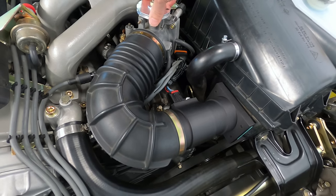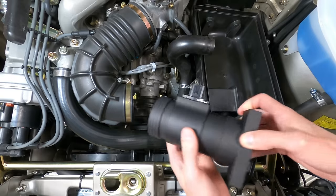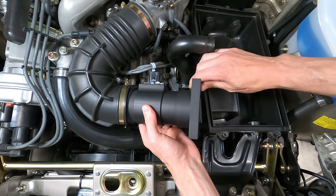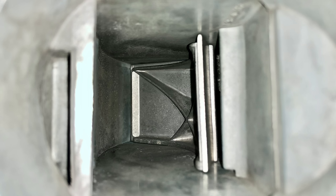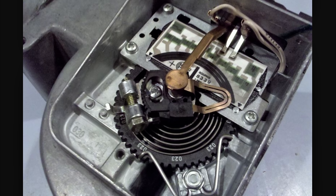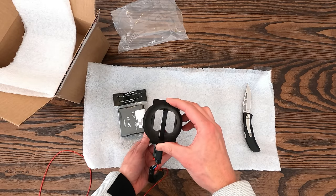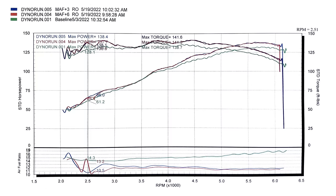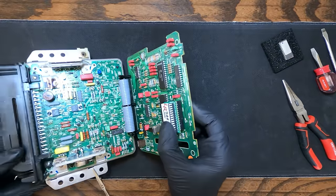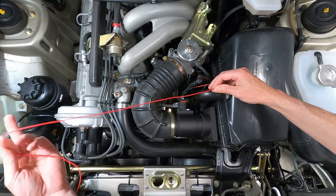Starting in the engine bay, the most obvious mechanical modification is probably the addition of Lindsey Racing's MAF tune kit in place of the factory airflow meter, which provides some reliability and performance benefits. The mass airflow blade sensor eliminates the mechanical flapper barn door and potentiometer setup used by the factory AFM that can create problems over time. The MAF setup offers a free-breathing intake design, and in this case it added a 5% horsepower increase after dyno testing. This modification is mostly plug and play; the EEPROM chip inside the DME computer needs to be swapped out and a 12-volt source identified to power the sensor.